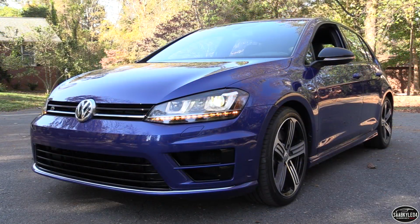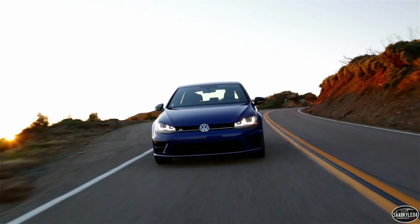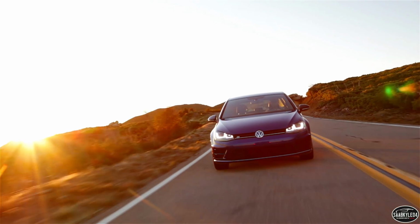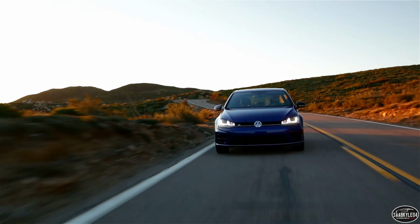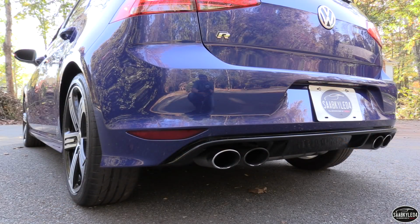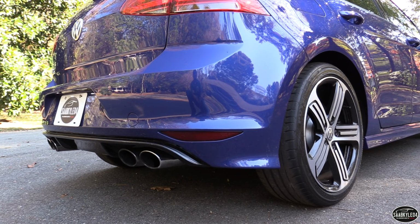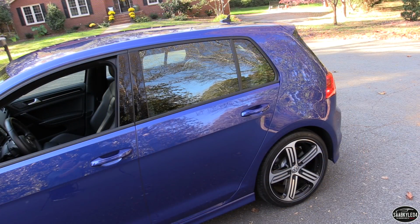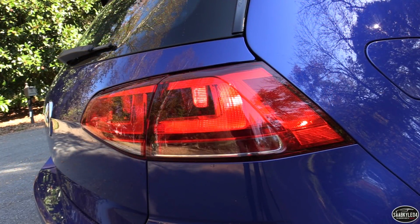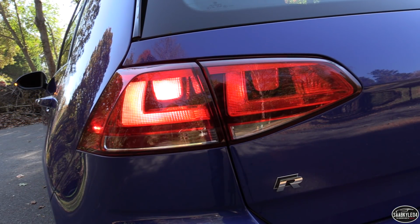The stamped steel body panels and chassis use more high-strength steel than before, now 28% versus 6%, while more advanced ultra-high-strength steels now make up 9% of the body shell, allowing for the use of thinner and lighter materials that can be tailored more precisely to vary the metal thickness based on the area and strength requirements. The unibody also has 2 solid-mounted subframes with bolt-on front fenders. All of this leads to a 10% increase in torsional rigidity and a drop of 51 pounds from the body in white. The new Golf is slightly larger with a roomier interior and more refinement.